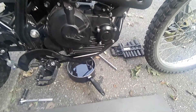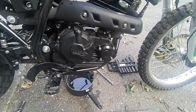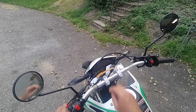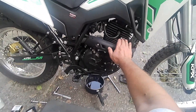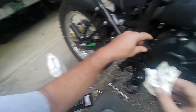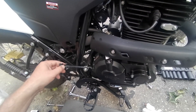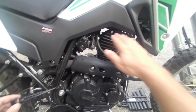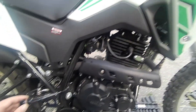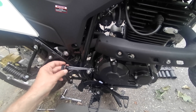Some people just drain that screen instead of the plug and get the same amount of oil out. That was about three to four minutes running — definitely hot. It's still coming down — might have checked it too soon before that oil got back down in the pan. Perfect.